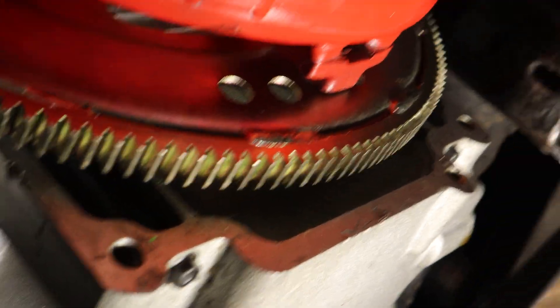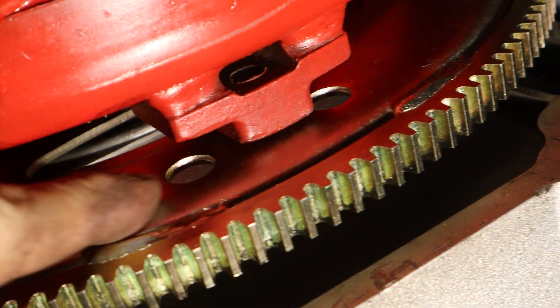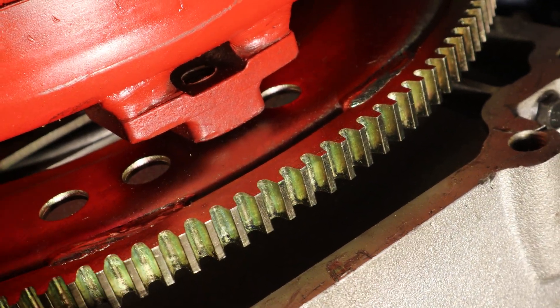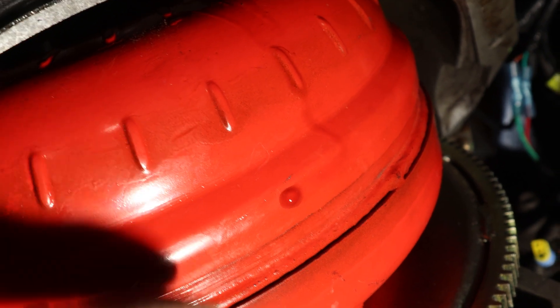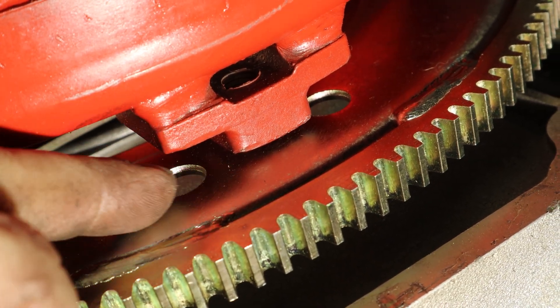I wanted to show you the clearances required when installing a torque converter. I've seen some confusion out there — people think you need this and that — so I talked to a bunch of people and got a lot of clarification to share. So let's cut to the transmission already in there. When they speak of an air gap, they mean the gap between the flex plate and the pad where the bolt goes. You measure it with the torque converter locked all the way back into position. I have about a 1/16" to 1/8" gap — probably about 1/8" — and they say you want from 1/16" to 3/16" roughly.